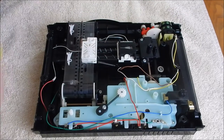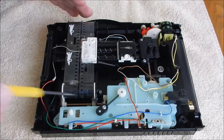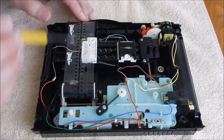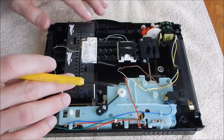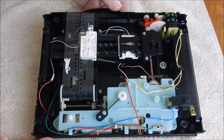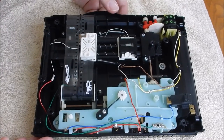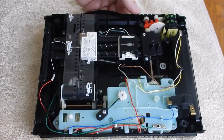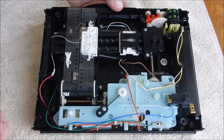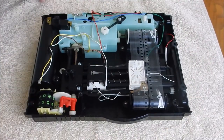Now we're ready for a quick check. All I want to do is test the film strip — I don't care about playing the game. Batteries are in, I'm going to turn on the machine and run it for about half a minute to a minute. This game moved a little slow because I didn't have the new motor in yet, but it served its purpose. I didn't see the film slipping anymore — it was moving pretty securely. That concludes the repairing of the film strips.